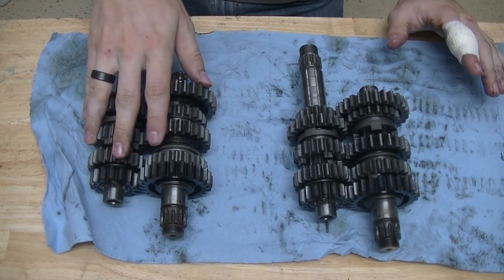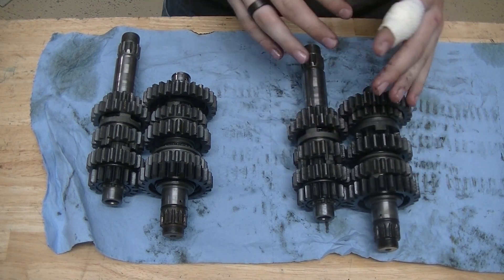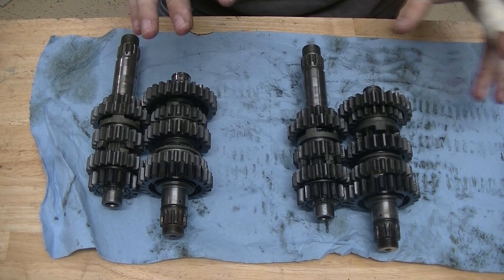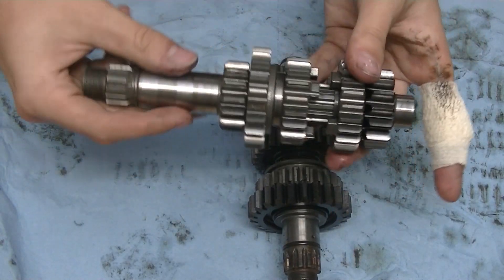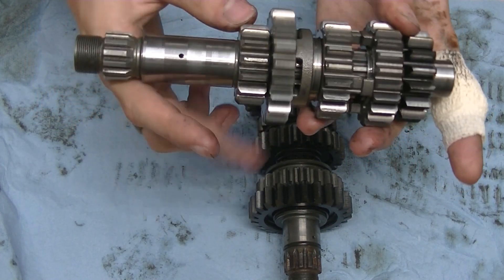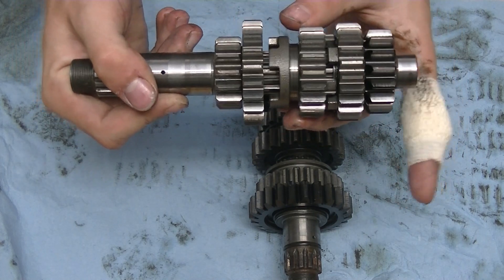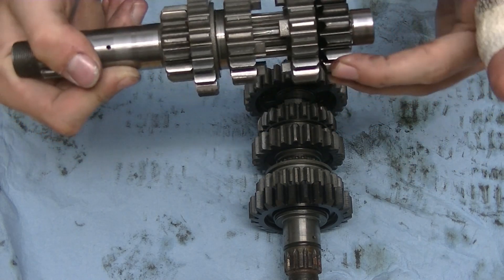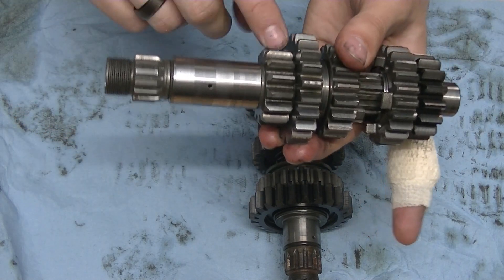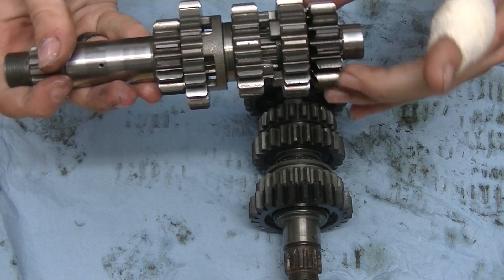Let's get started. I've got my bad transmission here on your left and my good transmission here on your right. I'm just going to blow through this bad transmission first and then show you all the good things about the other one. To get started, we're going to start with this shaft — the main shaft of the transmission. It's got one freewheeling gear here, a dog gear here, another freewheeling gear here, and this gear which is kind of a stationary gear on the shaft, just like this one here, except this one can move off, but it doesn't spin either way or move side to side.